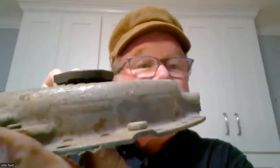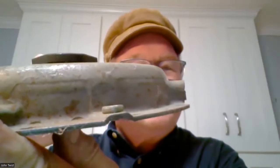And then we had replacement B pressure plates maybe 4 or 5 years ago that came with a different physical design on the outside, and there's no way those were even going to fit into an MGA bell housing. Yes, I suppose they probably would fit into an MGB housing. It must be bigger, later models especially. But when you're going for the three main bearing engines and the small bell housings, then the later model B pressure plate is not going to go in there. This is the old Borg and Beck style, and it's a pretty slim profile.